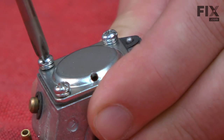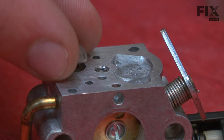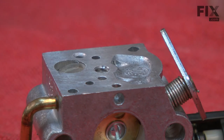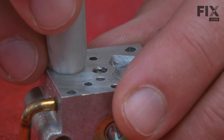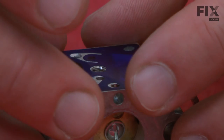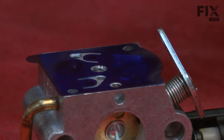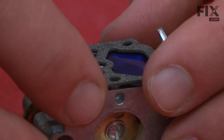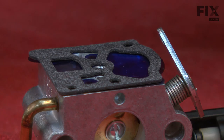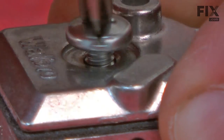I secure the cover with the screws. Now I've rotated the carburetor over. I'll first install the inlet screen — a trick I found is that the underside of a Sharpie marker is about exactly the right size to press the screen into place. Next come the reed valves, followed by the gasket, and the fuel pump cover. This gets secured with the screw.